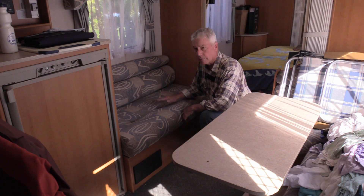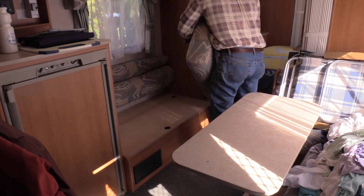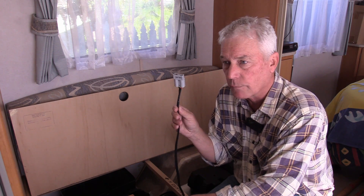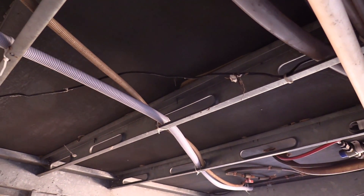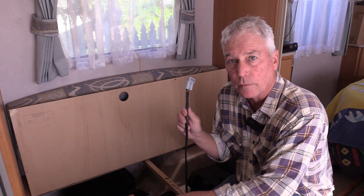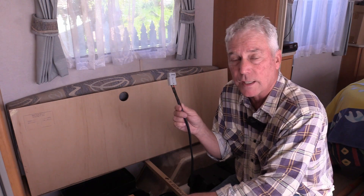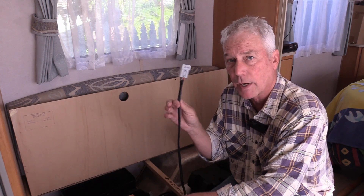The battery in the van is located under the seat. This is the wire I ran from the boot at the front of the van, underneath the van, through the chassis, up through an existing hole where an existing cable went out. It had silicone around the cable filling the hole. I removed some of the silicone, poked my 6mm solar panel wire through, and re-siliconed the hole. I put an Anderson plug on the end of the solar panel wire.